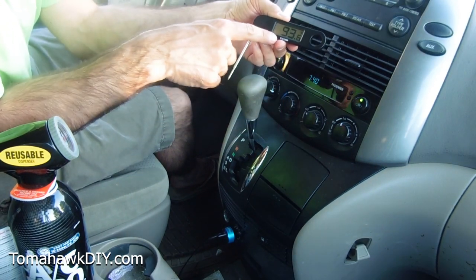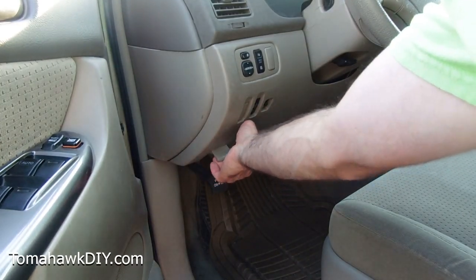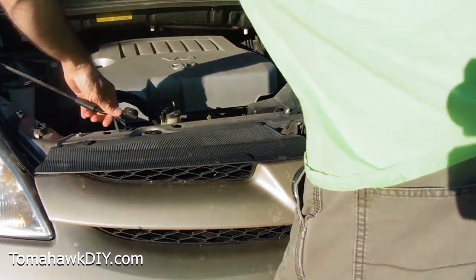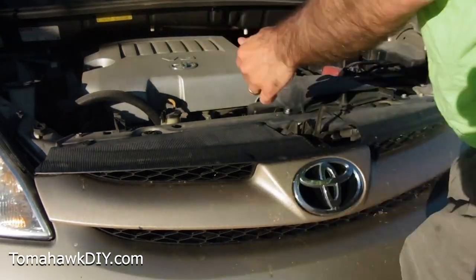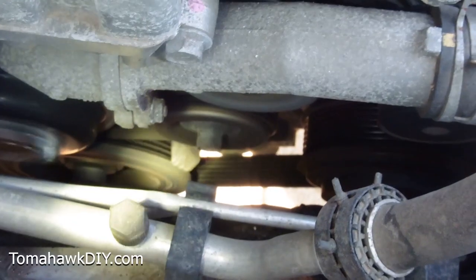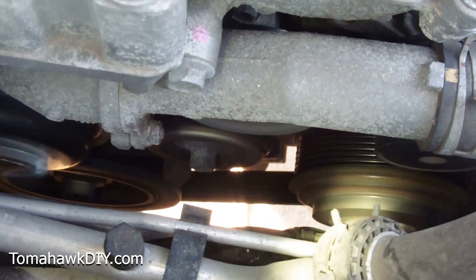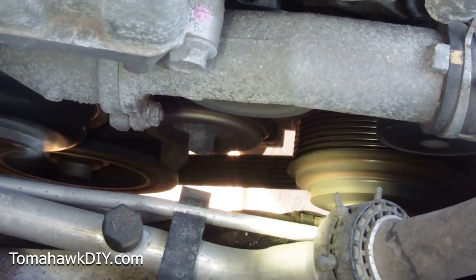We're going to sit it in — it's currently sitting at 93 degrees. Going to pop the hood. Step number two: figure out if the air conditioner compressor is running. We're seeing belts and lots of different wheels moving, and we're going to see if we can find one that stops when we turn the air conditioner off.